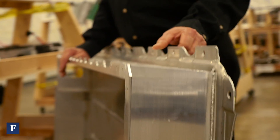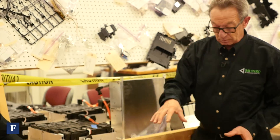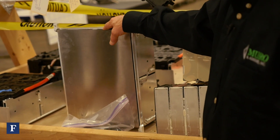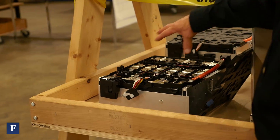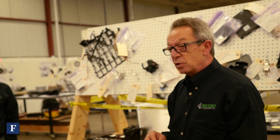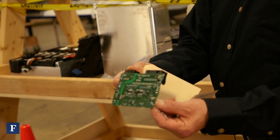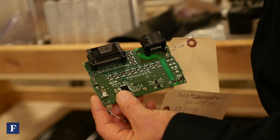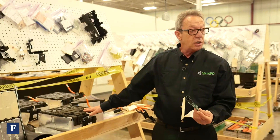This case is what the batteries sit in. Each of these groups of four bolts gets one of these battery modules placed inside — there are eight of them total. Each one of these modules contains 12 cells. The total is a 360-volt battery, with all of these modules wired in series. These eight modules are independently controlled because lithium ion batteries can have fires, so this little circuit board is an individual controller that manages the charge, discharge, and state of charge functions for each individual module.